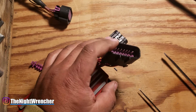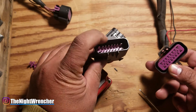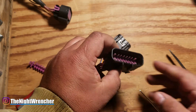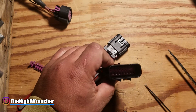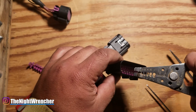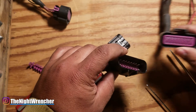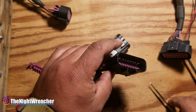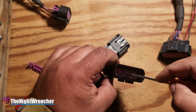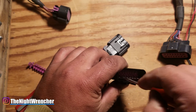The male connectors are pretty much the same as the female connectors. These ones with the spades would be the male connectors and they fit up just like this. Normally on OEM applications, you'd have a little tab in the middle that you could pull on to remove it — instead of having to stick a screwdriver in there. These MSD ones are basically tamper-resistant, so they don't include that little tab, and the sides don't give you enough leverage to pick it up with a screwdriver.